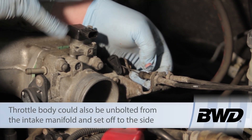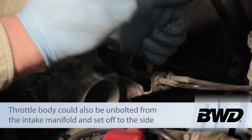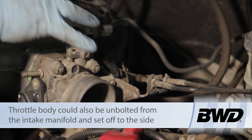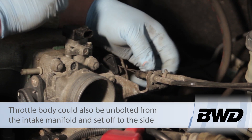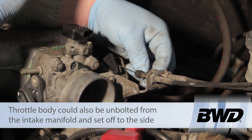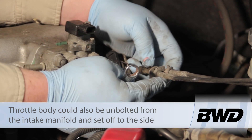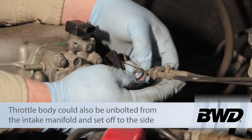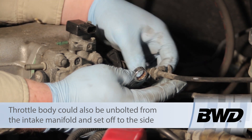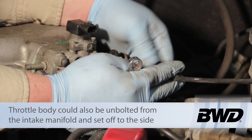I've got all the vacuum lines and a couple of coolant lines underneath the throttle body — I've pinched those off and set one aside. I've removed all the studs and bolts so everything's loose. Just got to get the throttle cable out. There's a cable for the cruise control and one for the throttle pedal. There's a lock nut and an additional nut on the front side. We'll loosen the front nut and use the bare spot in the housing to work the cables out, leaving one as a stop so we don't have to readjust it when we're done.